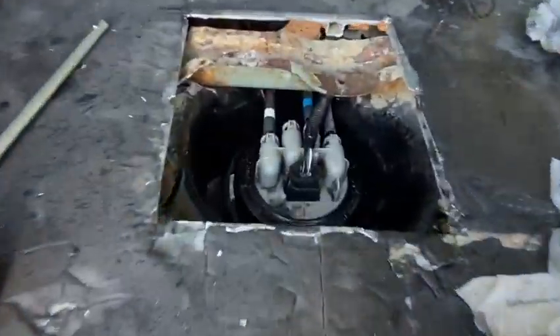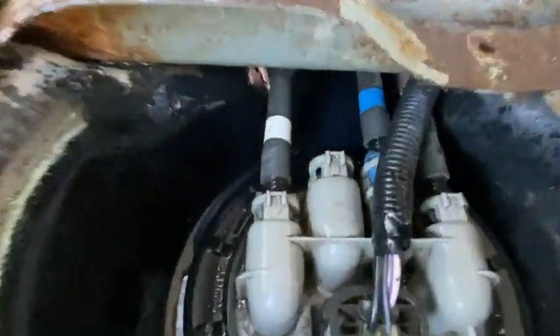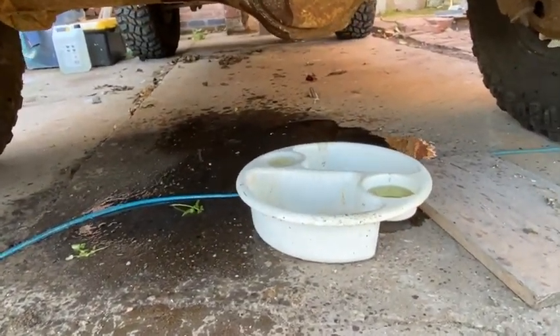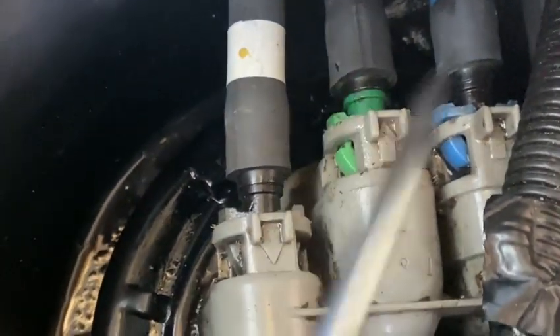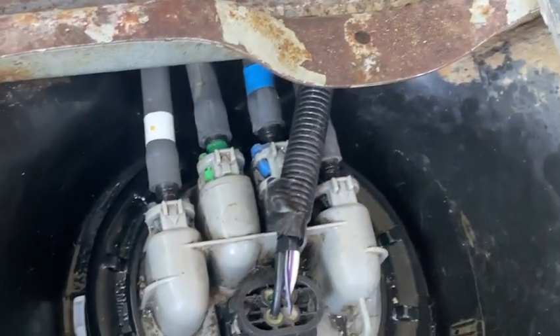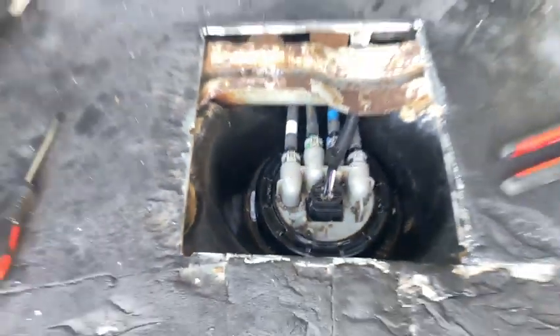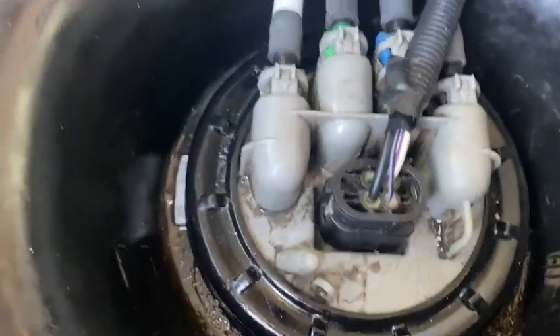The car works — but I quickly came back because one of the fuel pipes had just popped off and started spraying diesel all over the place, which is not great. The car did start, but I need to find that clip and get it back in — it was a green pipe that popped off. Those clips weren't fully in. Tip for anyone doing this: make sure those clips are really tightly pushed in so they're clicked back. Then turn it on again and the pump is running, engine is on, and nothing's popping out — no leaking either, which is good.